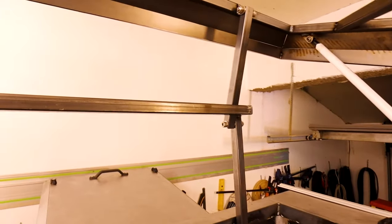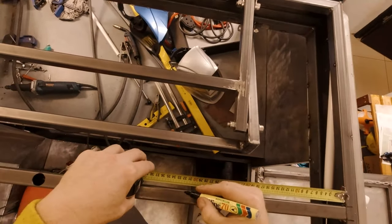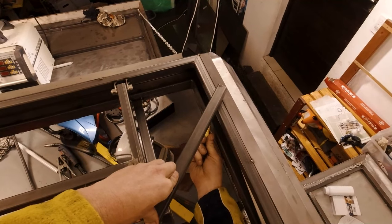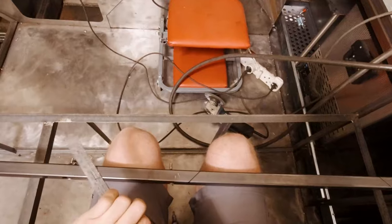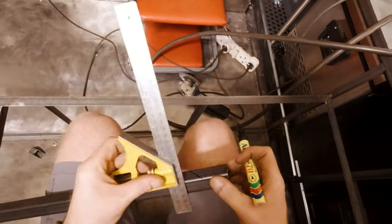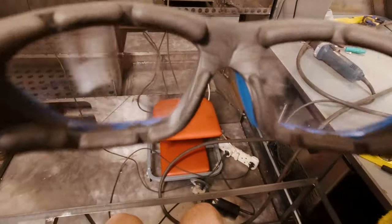Let me show you how I built this piece. Although the video is self-explanatory there are a few things to note. Another major advantage of having these cross bars is that it gives me more surface area for the adhesive when gluing down the fiberglass sheet. I want to use minimum rivets on that sheet if any at all. My thinking is to use Sikaflex that is made for car windshields — those sealants have some serious adhesion power even on ultra smooth surfaces like glass. Combined with almost no gap for the wind to grab onto the sheet, I can't see it going anywhere, but I might throw some blind rivets in there just for peace of mind.